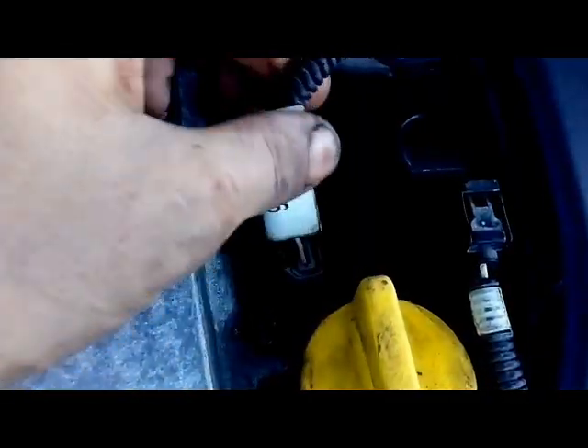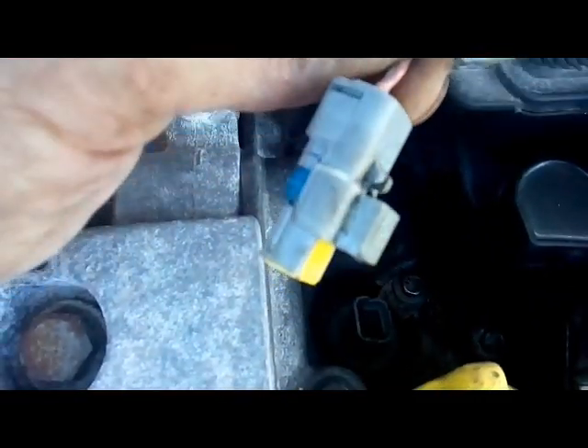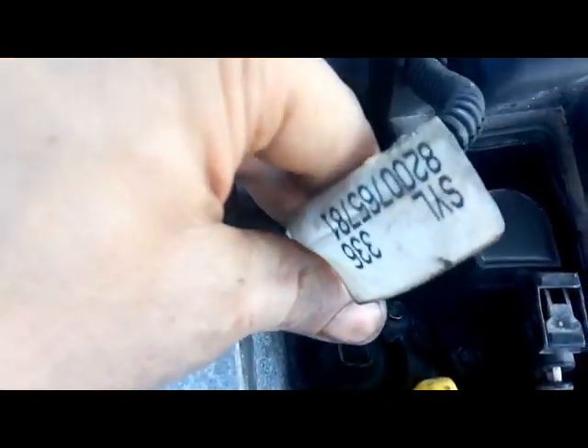Hopefully it's just vibrated loose, and if that's the case I'll just cable-tie it on, because the tab is already broken. The only way around that would be to get a piggyback wiring loom or part of a harness from somewhere. I'm going to check the variable valve timing solenoid — this bit here, just next to the oil cap. As you can see, the tab that's supposed to lock it in place has broken off, so I'm hoping it's just rattled loose, but we'll test it out.